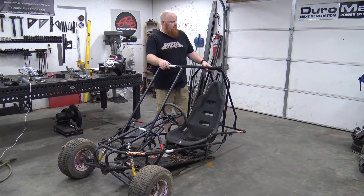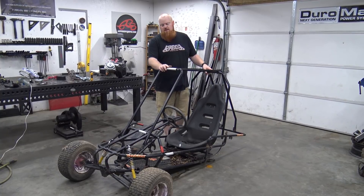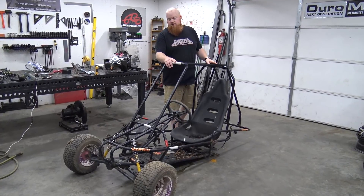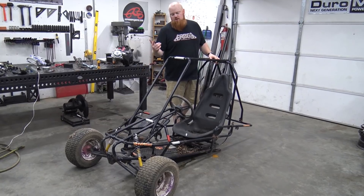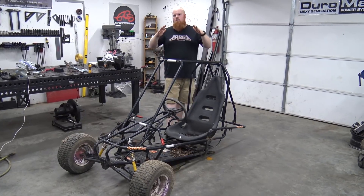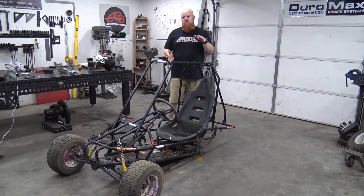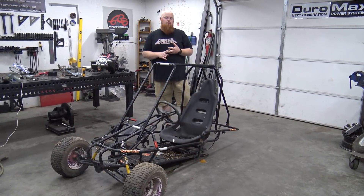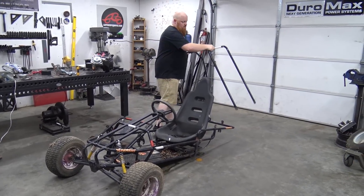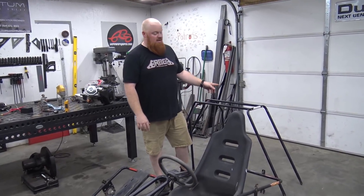Randy's been a good supporter of the channel - he's the one that put the floor in the school bus RV and he's been wanting me to build him something. This is a custom project: a Yerfdog single seater. It has a single a-arm design which causes cambering through suspension travel, giving less traction the more you flex. What he's going to do is a semi-independent rear suspension with heim joints like the blue go-kart we built, double a-arms on the front, and we're going to take this roll cage off because it's not even bolted on anymore and build him a weld-on roll cage - that thing will not protect anything if a kid flips it.